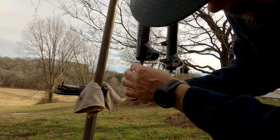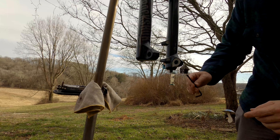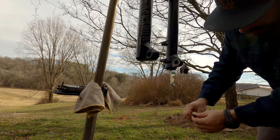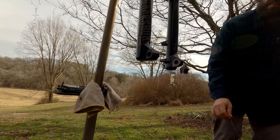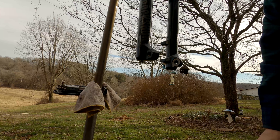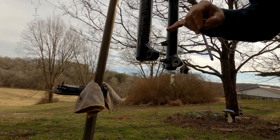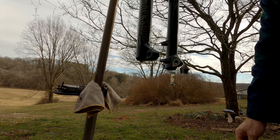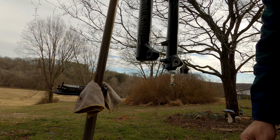Pull the rest of the bolt out. Wasn't much oil coming out of that one. Now the other side — oh yeah, there she goes. From that I can tell my rebound side has been leaking. I've been trying to get a new rebound damper for this fork for approximately two and a half years. Nobody seems to be able to track one down. RockShox has not come back to any of the dealerships I've worked with to get a new rebound damper for this 35 gold fork, so it leaks oil at the bottom of that side. I just have to keep refurbishing it and working with it as best I can.